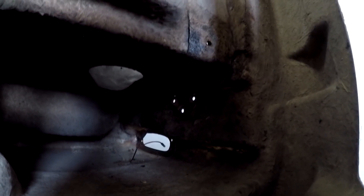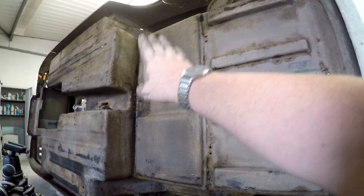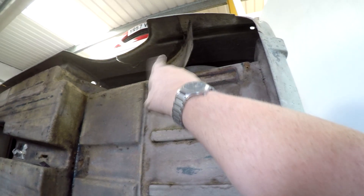So what I've got to do is put some sort of strengthening plate down the back here, and then fibreglass it on as well - that's the way I'm going to be repairing it. Bearing in mind I've got much more access now than probably they did anyway. I've done this bottom half now, just finishing this lower quarter off. All this has basically been degreased. I will go down the creases again with some white spirit just to dry all that off. Once this is dried off, this is ready for paint. I've just got the top section to do there and this rear compartment, and then I can start finishing off the repair.